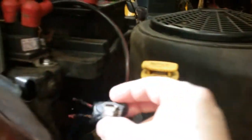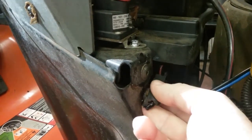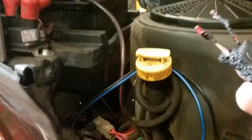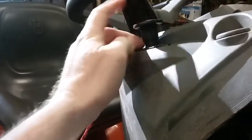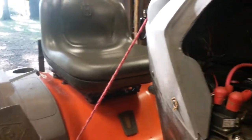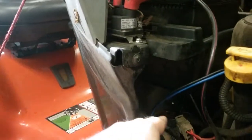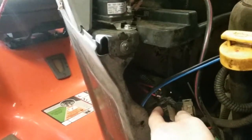Welcome to the Blind Guy YouTube channel. Today we're working on a Husqvarna mower again and we have an electrical problem. The problem is this melted fuse holder — it used to mount underneath this corner here, clipped on right there. The thing got so hot it melted when our customer turned the PTO on. She had her mower running, cut the PTO on, and that's when it started smoking and about caught the lawnmower on fire. Thankfully she cut it off; it smoked pretty bad and melted the wire loom down here a little bit.